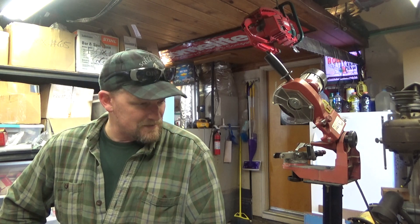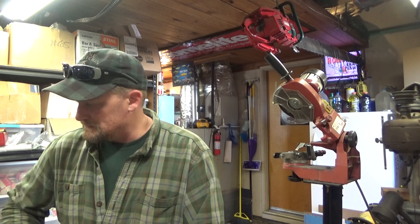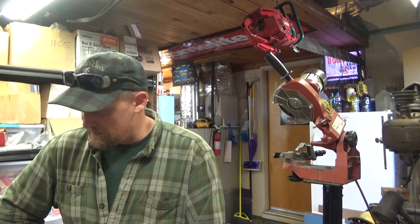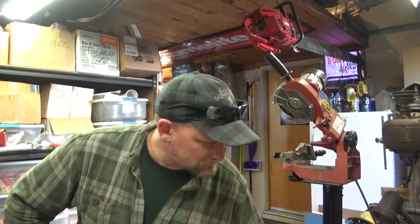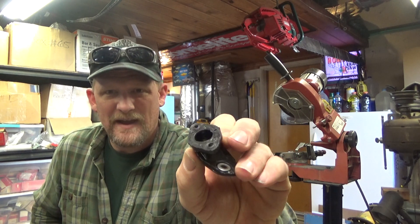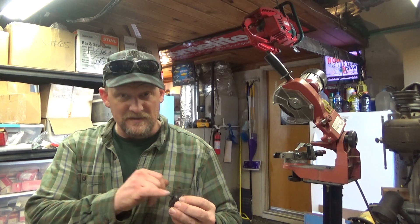I don't think I've posted anything about this. I wasn't happy with the quality of any of the videos I did, mostly because of my own disposition in those. The fast idle trigger lock — I've got the directions on how to replace that. I don't know how any tech ever did it. I tried for close to three hours and I could not get a spring up in there. That is one of the most nightmarish things — I disabled it. It was running okay, but it was real slow to start. One of the first things I noticed was that somebody had been over-tightening the carburetor badly, because you can see how the intake is all indented in there. My best guess is that it wasn't sealing around the impulse hole.